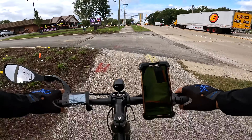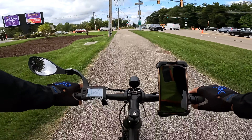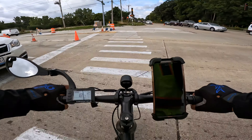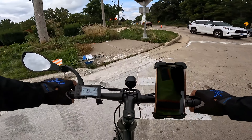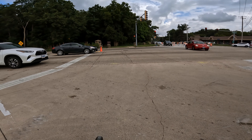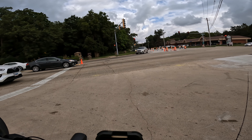You're probably wondering about the range — we need to find that out to know if this bike is worth considering. We have decent power even at 350 watts. The battery is a 7 amp hour, 52 volt battery. People were comparing to other bikes, but some of those are only 36 volts — this one's 52 volts, and maybe that's why we're getting the power.